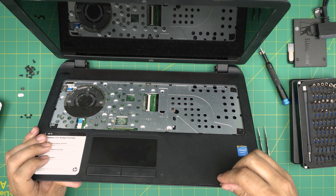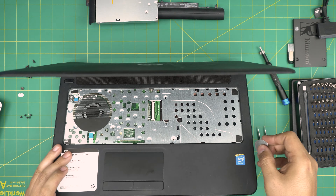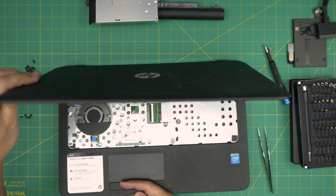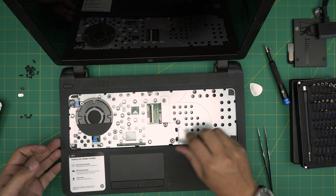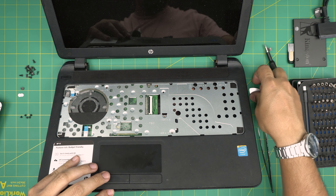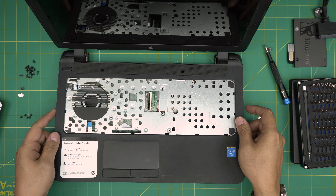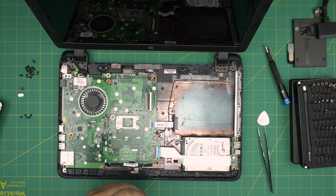Once the five screws are removed, stick the opening tool between the palm rest and twist it. Work yourself all around — in the front, towards the DVD drive, to the back corner, and along the side. You want to hear those big click sounds. Grab it from the front, pull it up — you'll feel something holding it; those are just tiny hooks. Pull a little harder and it will come up. Wiggle around and it will release the hooks on the back side.